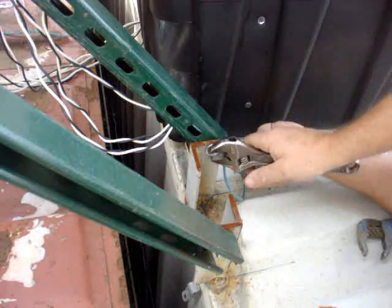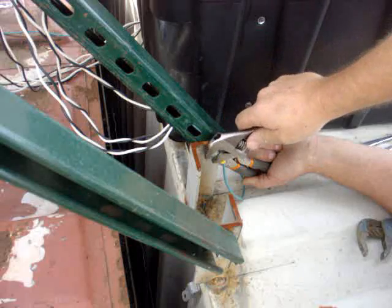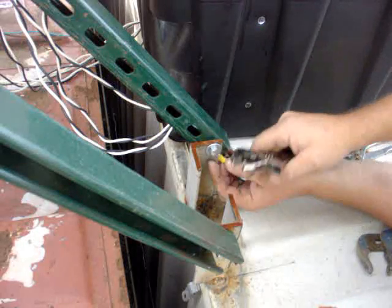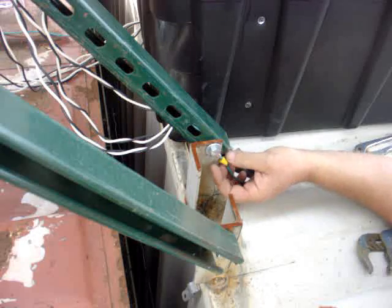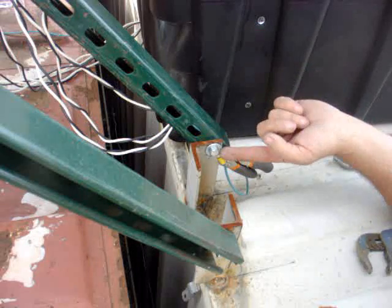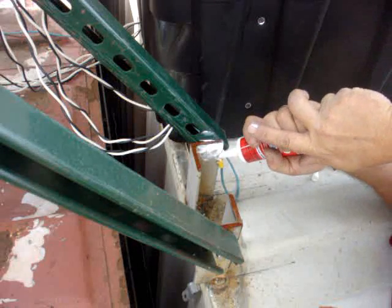Without the washer you could be doing a lot of damage to that lug — that would not be good. This is tightened up. I'll bend this out a little bit; it's not going to matter being a ground. I'm going to go ahead and seal all this up with silicone — that'll keep this inside from rusting, causing corrosion, and a bad ground. It'll keep this joint good, and there we go, that's got it all sealed up.